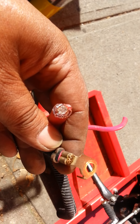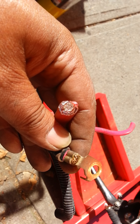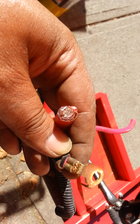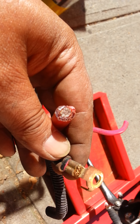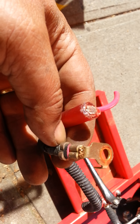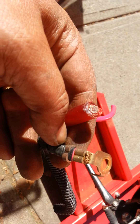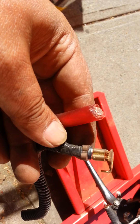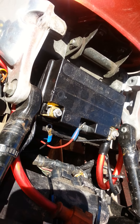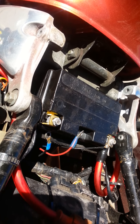Hopefully this is going to resolve my issue. People are talking about upgrading batteries and all that other stuff, but my reason for doing this is because when everything is hot, if I stop — say at a drive-thru — and go to start it up, it won't start. It acts as if the battery is dead. Apparently it's not getting enough electricity through the wires when they're hot. Somebody said go to the fatter wire, and even when they're hot the resistance won't be as dramatic, so it should start without having to let the wires cool down. Plus it looks cool.